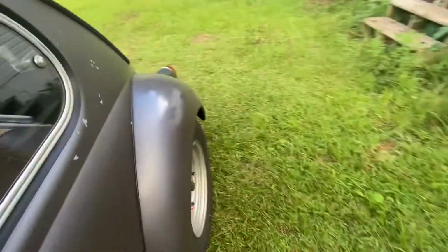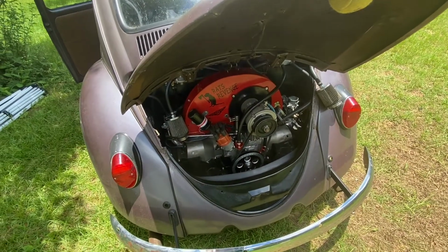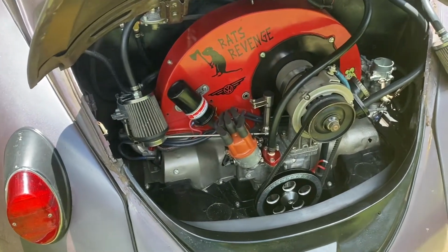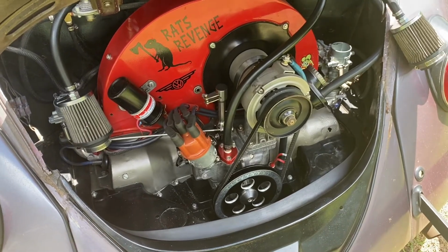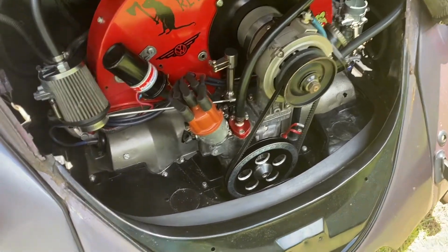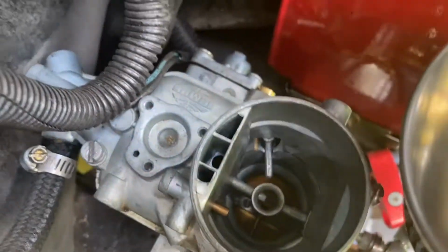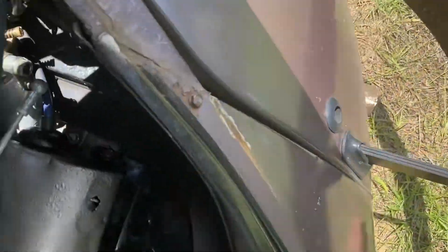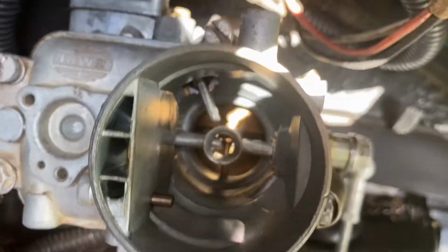Okay, just got back from a long, hot run. So it's been about 20 minutes, and I've been coming out here every 5 minutes and checking on it. I haven't seen any wetting of the throttle plate, or definitely no gross leaking of fuel in there. But I'll see if I can get a light in it. And you can see those carbs are staying pretty dry, no sweating of fuel onto the throttle plates.